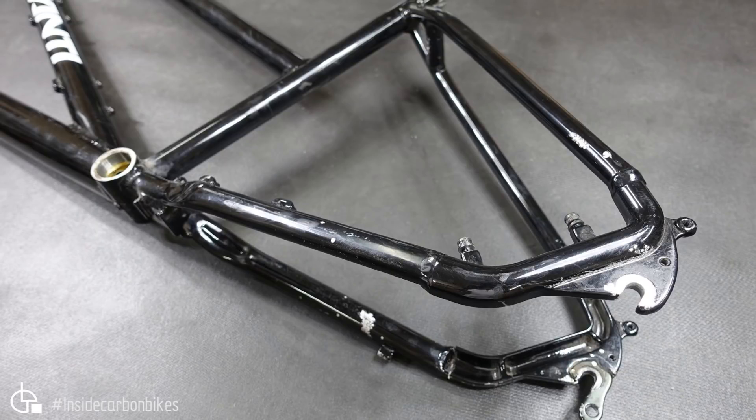Surprisingly, you may not know this, but it's quite common in defence circles to do composite repairs on metallic structure. There's been a lot of work done in this area on battlefield repairs for metal airframes. The defence group I worked with in the nineties repaired a Navy frigate which had an aluminium superstructure that developed cracks. In the area where the crack was, welding was very difficult and costly because all the electronics were in the adjacent areas just below the crack, and that would cause problems with the high-frequency welding equipment. So we did a composite repair on that area, which as far as I'm aware is still operational.